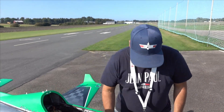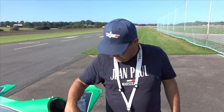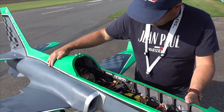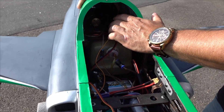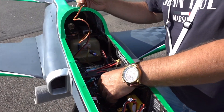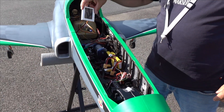If we take a look inside, I have one turbine battery, which is a 2,700 3S for this. For installation, I have a fuel pump up here and my ECU here. And an air trap — I have a Digitec 100 milliliters.